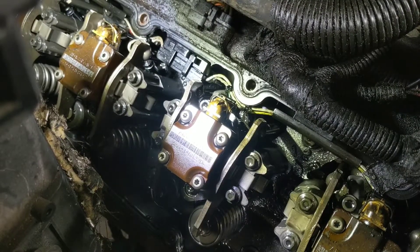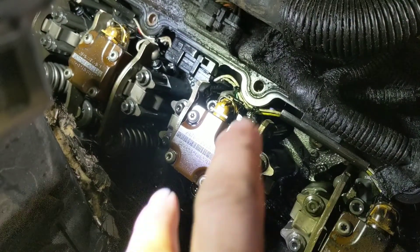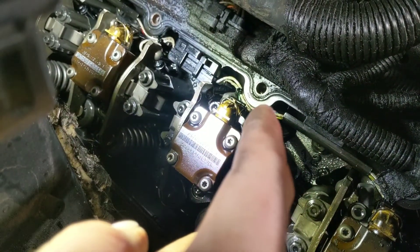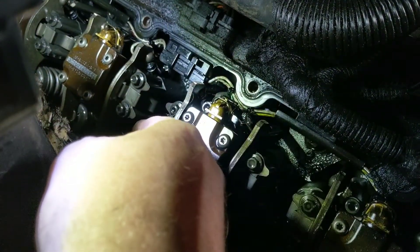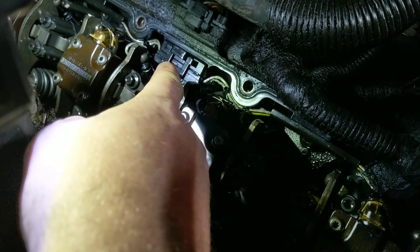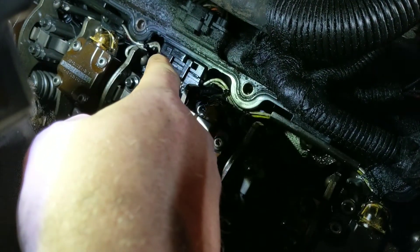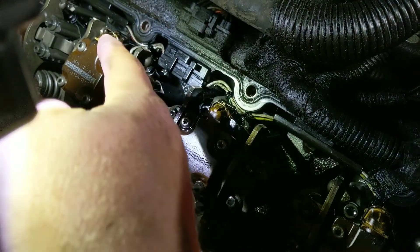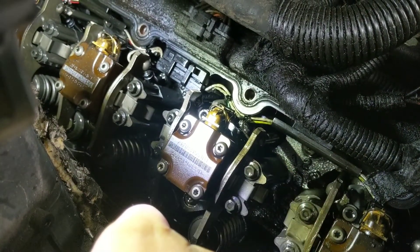Removing these injectors is not as difficult as it looks. There's basically just one bolt to remove down here, a plate that you slide up and pull back. First thing you need to do is get the gasket off — it's basically a piece of plastic with o-rings on each side with a pass-through connector that has plugs going to the injector and glow plug. Disconnect those plugs, get the gasket off, unplug all the injectors, and get the wiring out of the way so you don't damage anything while pulling the injectors.